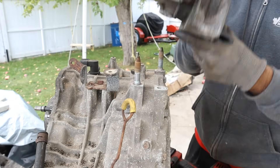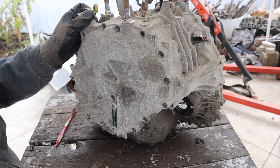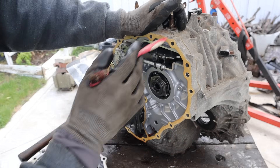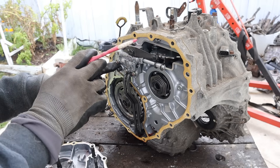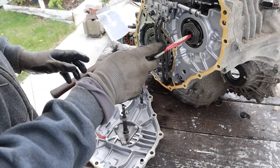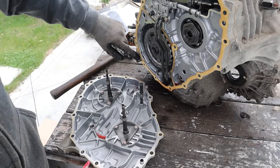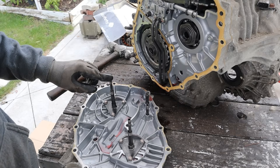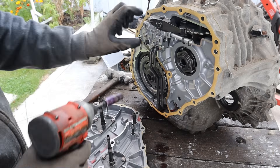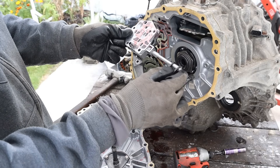I need to remove this transmission mount and the bunch of 12mm bolts on the back side of the transmission housing. This mechanical switch is going to engage the parking pawl on the back side of the transmission. Then we have a manual valve which is going to control the direction of that clutch — there's no electronics inside of this transmission, it seems like it's all mechanically controlled. This would be the input variator shaft and this would be the output, and you can see they've got these two tubes which are fed by the two tubes coming off the side of the transmission. On the casing we have apply and release for the input variator, and apply and release for the output variator, and those line up with these two holes and two tubes respectively. I'm going to remove this little manual valve — it's like a mini valve body, and this is the manual valve that's going to move with your parking neutral switch.